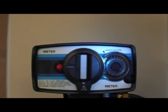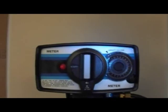You do not need to turn the water off to change the timer motor. Just remember to unplug the electric. You will need to work on this from the back. I am going to cheat and spin mine around. You would not be able to do this without disconnecting some plumbing.